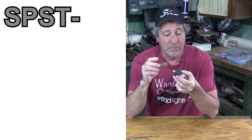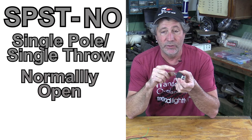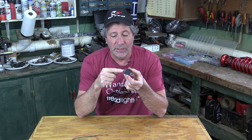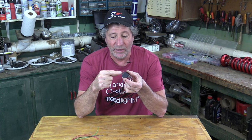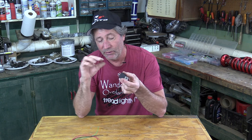This one is a 40-amp relay. Not to confuse you, but relays come in a variety of configurations. Some, like this one, when power is supplied from a dash switch, turn on a circuit. Others, when power is supplied from the dash switch, will cut off a circuit. And then there are others where if you provide power to it from a dash switch, it'll switch from one accessory to another. So make sure you get the right relay.